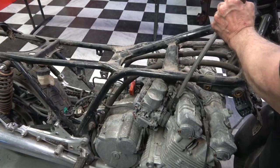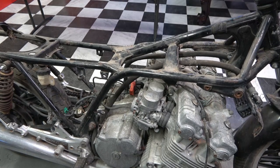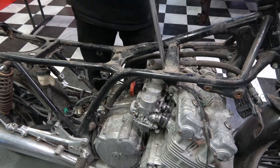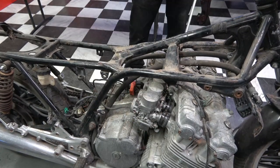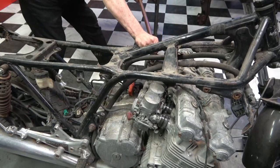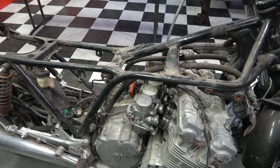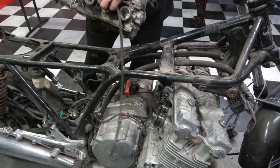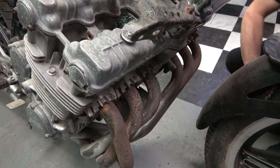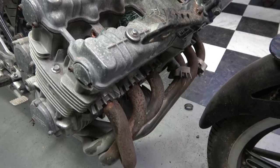In this scene I'm taking the carbs off. What I use is a very long tire iron with a pipe connected to the back of it so it's about five feet long, and I literally pry the carburetors out. You have to be careful to only put the pry bar in strong areas of the carburetors — big aluminum blocked areas. You put a lot of WD-40 and pry them off. I always do this before removing the engine from the bike because then you've got a lot more leverage.